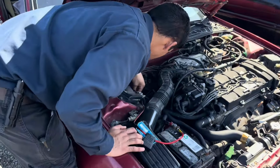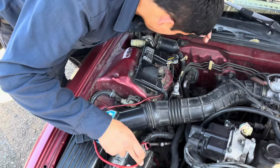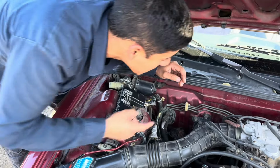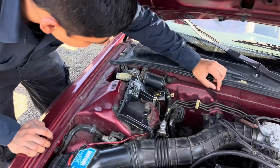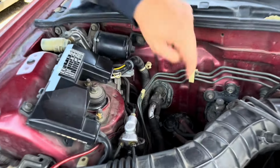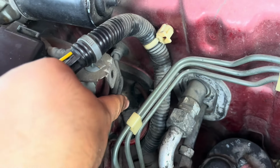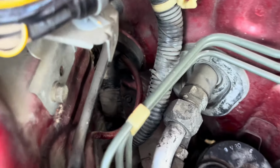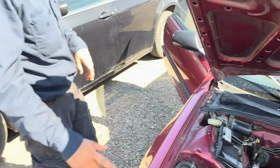So look, we did this. You have to find a way to get this power cable to go into the cabin, all right? A lot of people like to do it through the door jams here, but that sucks. So find something like this. This is the AC though, but I did mine on the actual computer grommet. I actually just had to poke a hole through it. You have to snake it through. All right, so anyways, guys, we're there, okay?